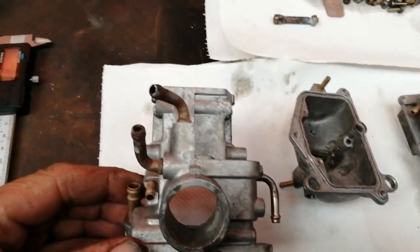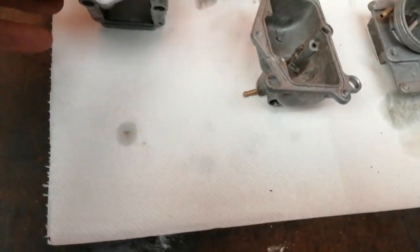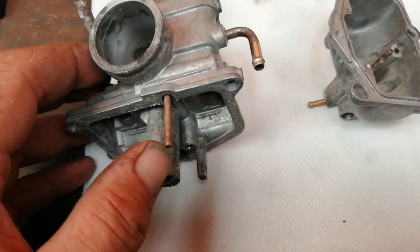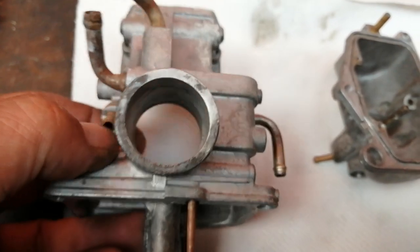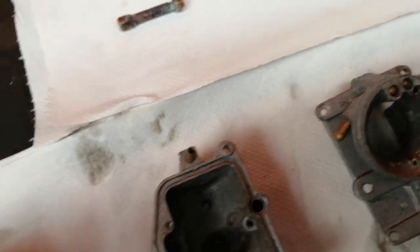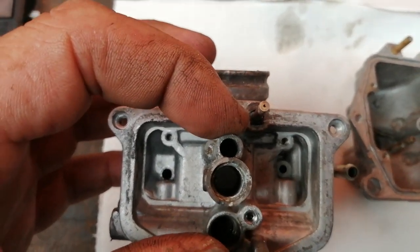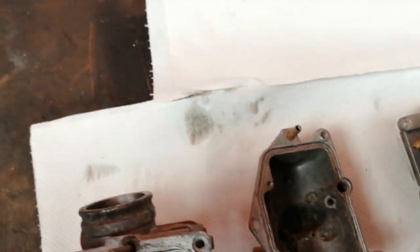Get your old body — this is quite a corroded one. It's been through the ultrasound but it needs some more time to get cleaned up. This is the top body of your carb. As you pick up for your choke, that pipe there feeds the actual choke opening, which is controlled via the plunger. When you lift the plunger, that opens up a rich fuel supply. In there sits the slow running jet, which is a fixed slow running jet. And your main jet screws in there, which goes into the top of the emulsion tube.